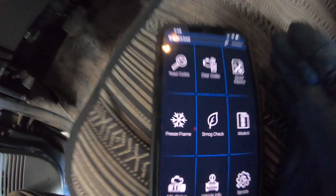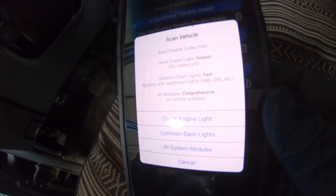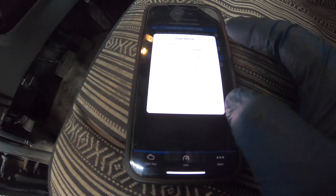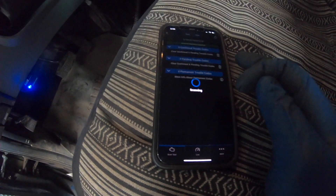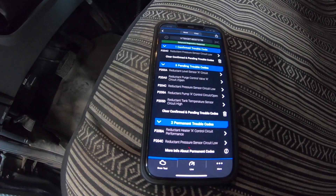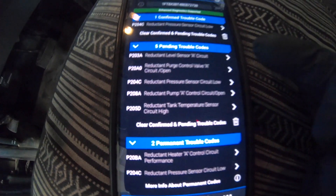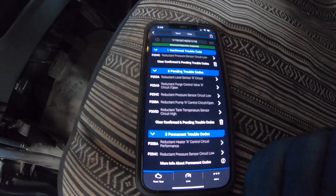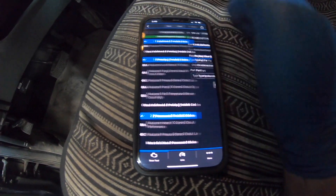It takes a second. Now I'm going to read the codes. You can do check engine light, common dash lights, ABS — all that. All modules takes a long time, so we're just going to do the check engine light. Scanning... 0, 50, 100 percent. We've got a bunch of codes here — reductant level circuit, open range, all these sensors. That's because I've got a plug underneath unplugged because I'm working on the wiring. Clicking it gives me a better report, but in this case it's a kind of weird code.